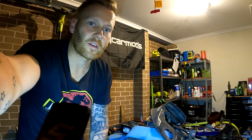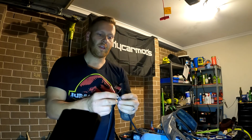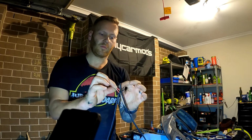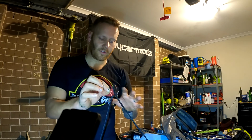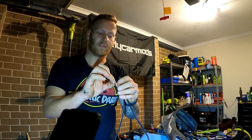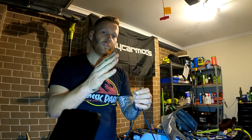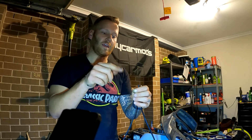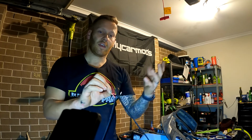Now, as I was saying, what we're going to do is both these wires will come to a join. So they will join together like this, and then we'll probably find a common earth and maybe just extend these out, I don't know, 30 centimeters, maybe a foot. Depends where we can find an earth fairly close to where we're going to mount this. So this side will be together, and then on the opposite side we'll have the output of the switch. So it'll come from the battery through to the fuse to the switch. So it'll come into the switch on one side and then out the switch on this side, which will then complete the circuit. Obviously these will be earthed and then the circuit will work.